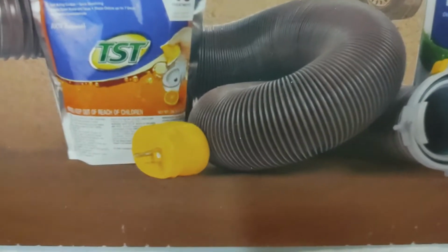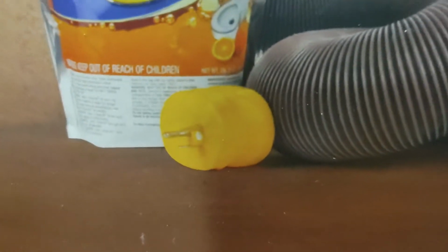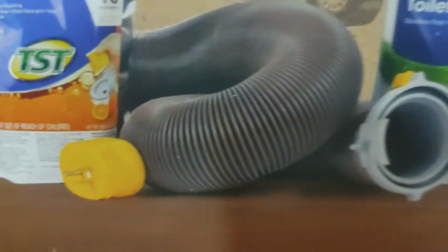It comes with a 50 to 30 amp adapter, and then down from 30 to 15. With 30 amps, not including this, and you're plugged into 30 amp, only run 1 air conditioner. On 15 amp, only run no air conditioners. I mean, none, 0. You will damage your air conditioner or the coach itself.